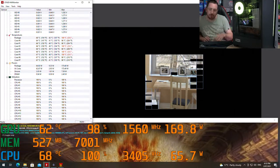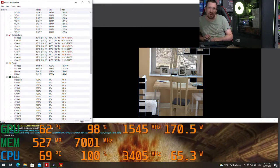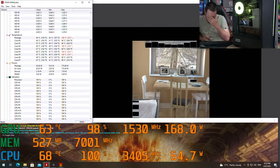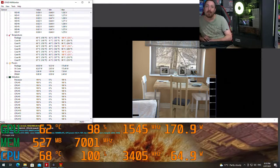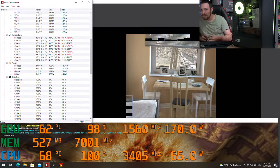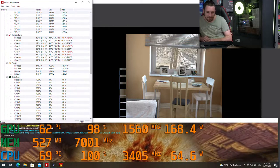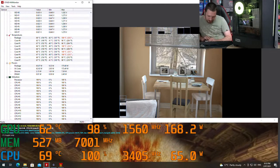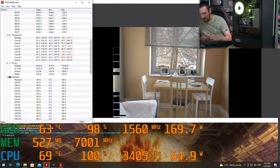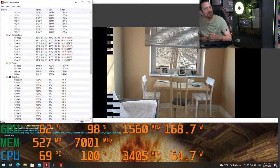Me and the business owner up there, we were just joking around, and we're like, yeah, it's probably a motherboard. I'm like, if it's a CPU, oh, what are the chances? It's got to be a very, very low chance that it'll be a CPU based on what we saw. Anyway, he brings it in. I send him up a new motherboard, and then I get a call from the guy, and he's like, man, it's the same thing on this new motherboard. I think you got a dead CPU. And I just couldn't believe it. So I sent him up a new CPU, put the new CPU in the new motherboard, worked straight away. So someone else ended up with that extra motherboard, but they got a good price on it.